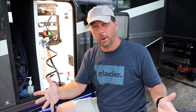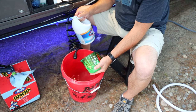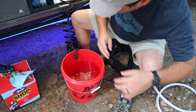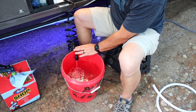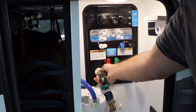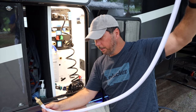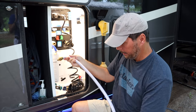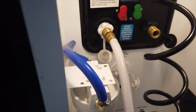Our system has a 150-gallon freshwater tank — actually two tanks that are connected, essentially one 150-gallon system. Using the ratio of one cup per 50 gallons, that's three cups of bleach. Rather than have three whole cups in one bucket super concentrated, I'm going to do one cup per bucket and do this three times. Try not to get it on your clothes — you're wearing video clothes, not work clothes. That's one cup of bleach and roughly — this doesn't have to be a perfect mixture.